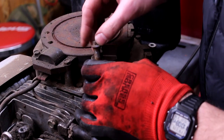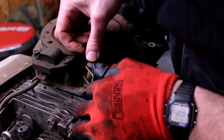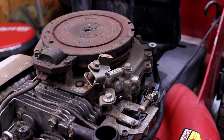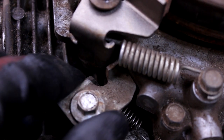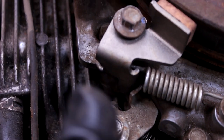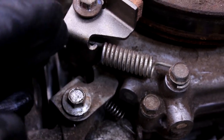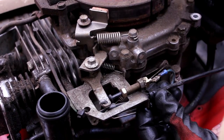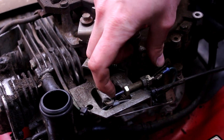So then if I remember correctly, this is pretty straightforward. I'm going to get the ratchet. I'm going to make sure that this piece right there at the tip, which is connected up here, is behind that piece. You don't want it to be looped up over that little notch. You want it to be on this side, because when you pull that lever, it pulls that back, which then puts pressure that way, which then opens up that brake. Now, what we're trying to figure out, we need this cable to be putting more tension on that so that way we can release that.